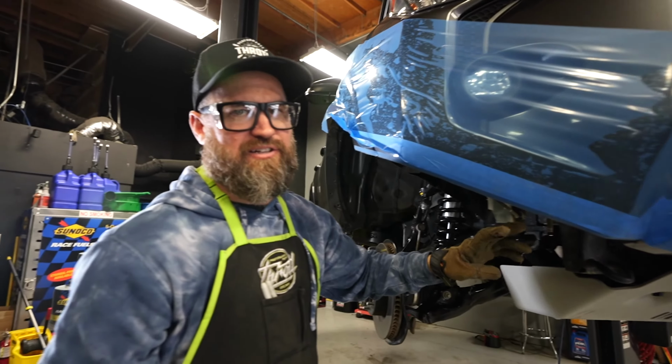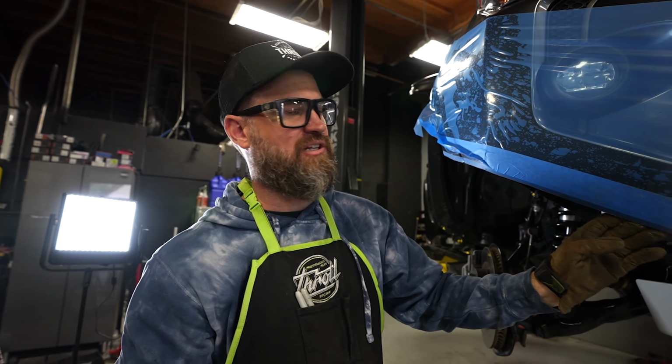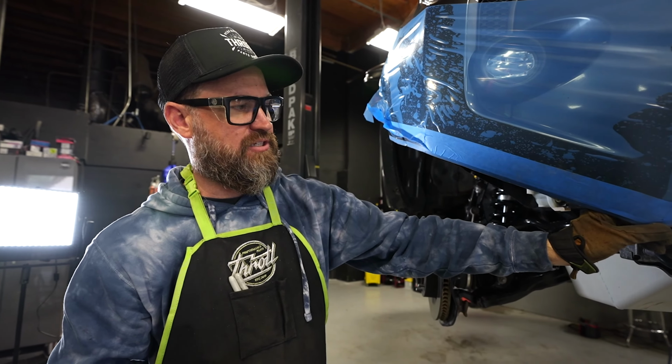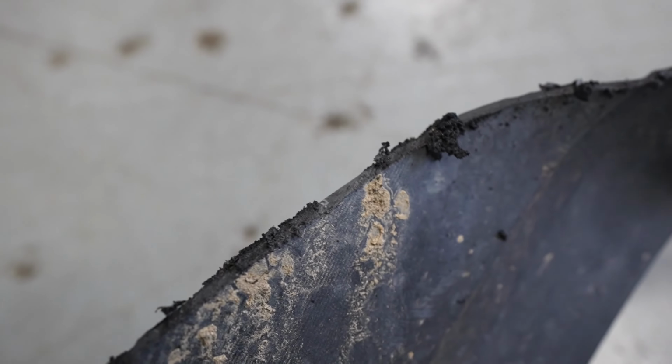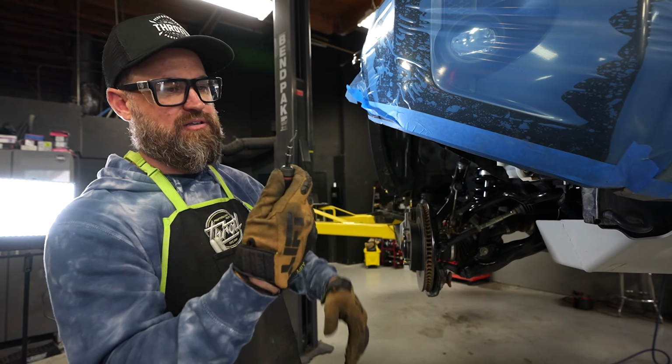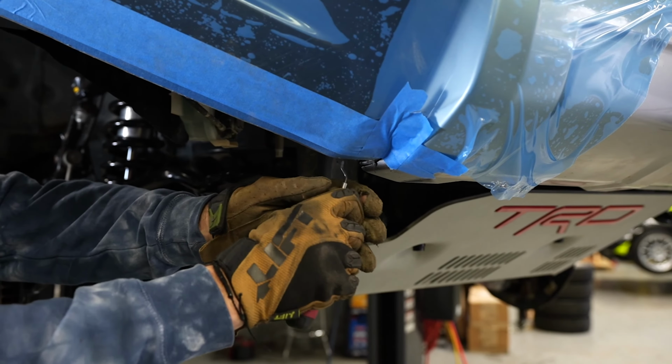When I cut plastics, a lot of times I like to use a deburring tool just to knock off the extra slag that happens when you cut plastic. You're burning it, and it creates these balled up melted messes of plastic. A metal deburring tool actually works really good on plastic to clean it up.